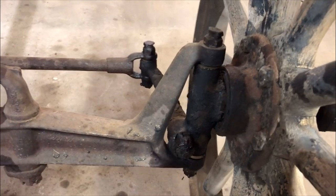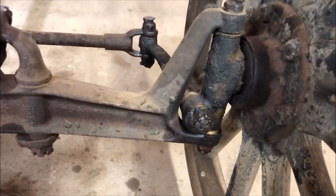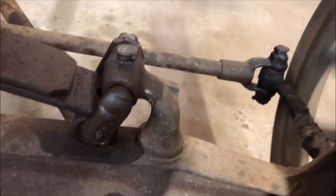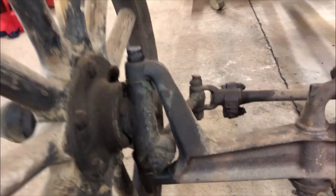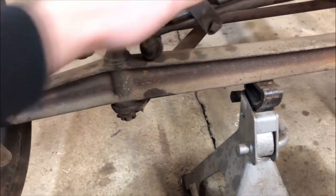These kingpin bushings are pretty loose so those are going to be replaced. The wheel bearings sound pretty good. Right here there are bushings that get worn out — they have little oil caps that are stuck, but that's how you oil those. This king bushing is pretty loose too. We're going to be replacing all this stuff. These leaf spring shackles will get replaced. It's all going to be restored and looking pretty nice before we know it — it's a pretty nice original car.